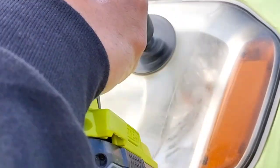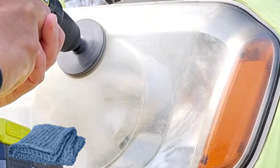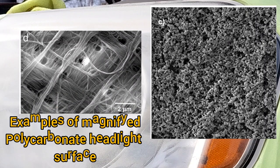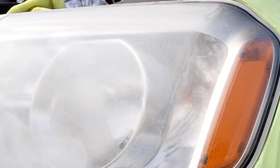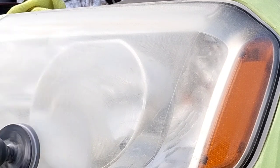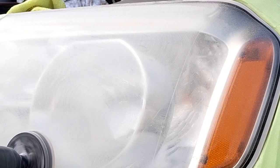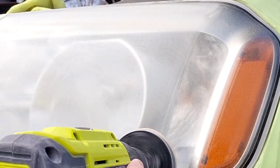So, you know, it either looks like that or it looks like a blanket, like a woven blanket or a sewed together blanket or like a handmade stitch blanket, whatnot. It looks like that, and when people continuously polish the lights, what is happening is those polishes are going into those caverns and into those pockets, and they're drying out sooner or later. At first, they pretty much, in a sense, bleach the headlight. They don't remove a sufficient amount of the surface residue, okay?